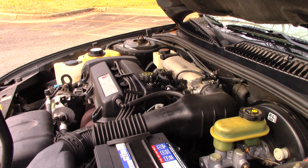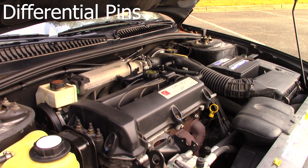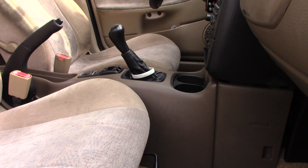Another common issue is the diff pins. The diff pins in these things like to literally punch through the transmission casing — not even joking. They'll come out of the transmission one way or another by brute force. The remedy for this issue is to stay on top of fluid changes — not just oil. If you're only maintaining your oil, you're not maintaining your car. Transmission fluid is a big thing too. Also, don't do donuts or burnouts — every time you do, that's going to stress the diff pin. The top fix people do is simply weld their diff pin in place so it can't move anywhere.